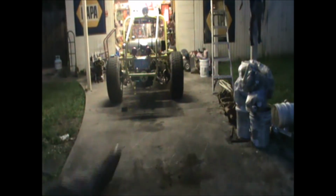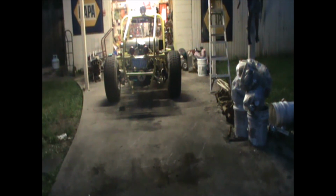Sometimes you have to do what you got to do to get this in. So far that's it. You know, this torsion is basically in right now. We definitely got to get the coupler for that shift rod, because I've had a heck of a time trying to get this thing into neutral, and I still haven't got it. We just picked it up, and both of us just kind of picked this. He was on this side, I was on that side. We just kind of picked and dragged it over here, and same thing with the front to get it out of the way. I want to be able to get my rail out, so if I want to go drive it, I can still pull it out. The last thing to do is get rid of all this rust from cutting out the original torsion.